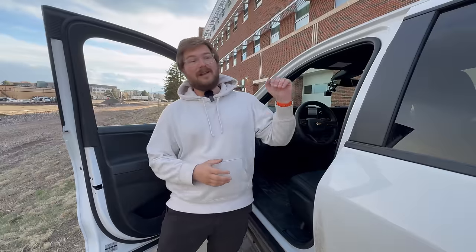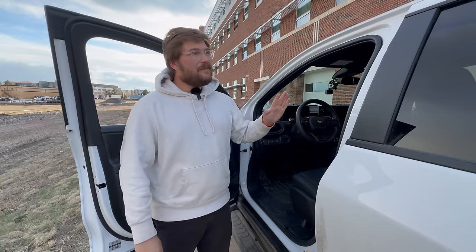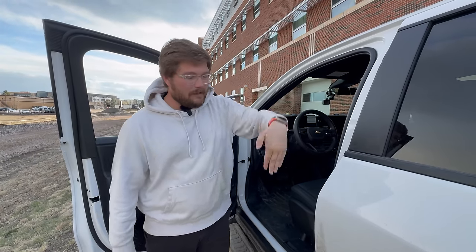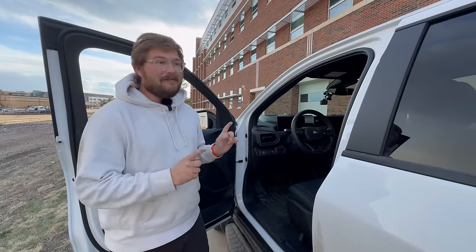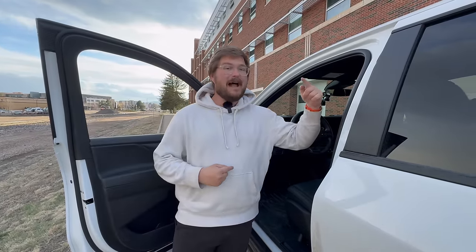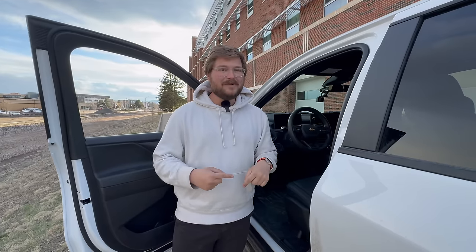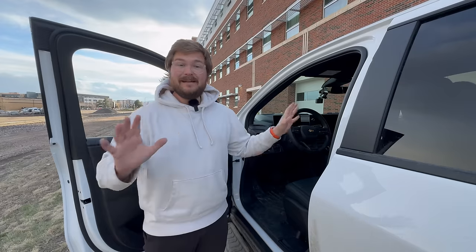We are going to have to do a lot of regen. And one thing is, we always leave on this test at 100% state of charge. After the first hill climb, if you guys remember from the last episode up Rist Canyon, we're going to be coming down for a couple miles. Now, this being a big battery means that we're actually gonna still be probably at higher state of charge than the Cybertruck. Will it be able to regen that much? I'm really curious to see. It also does quite a bit of brake blending, a lot to get into.